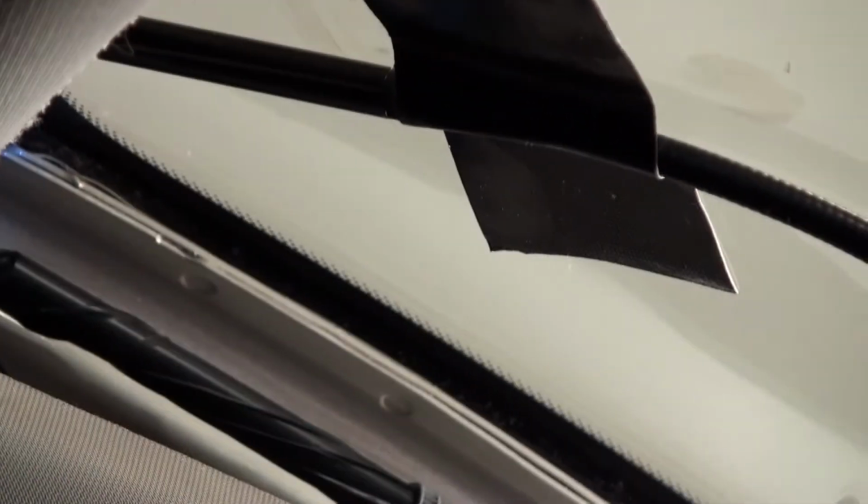Okay, we've got this Chevy Malibu 2015. It has setting posts. Again, we want to show clearly how you take the trim protector that you can remove from the tool, but you would have it in the tool. I'm going to show you where to place it on the windshield so that you slice off the setting post and the line doesn't go through the plastic and then break.